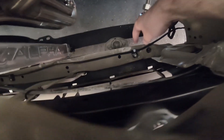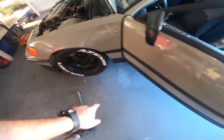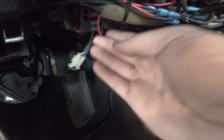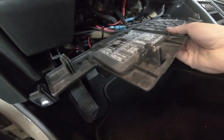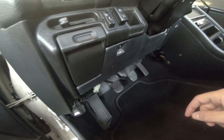Alright, let's recap everything we did for the fog lights. What I didn't show you is I added a connector there with a riv-nut — one there and one down there too. If we get underneath the car you can see the wires tying in and they're going underneath the crossmember. We showed you the right side of the fender well, came into the door, and here's what it looks like — everything's butt connected there. Again I soldered everything and just zip tied it all up so all the wires are nice and tight and out of the way. And once we put the cover on — all clean — and there's the connector.